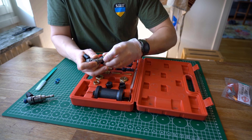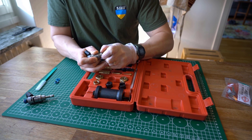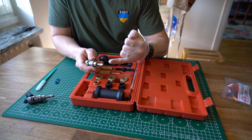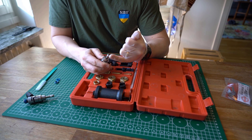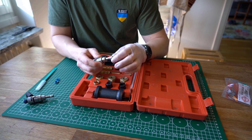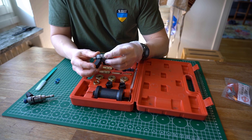Give the size two tool a few more turns. That's pretty much it for the Teflon seal. Make sure the surfaces are clean — I used some gasoline before starting this video to clean the tip, nozzle, and the rest of the injector.